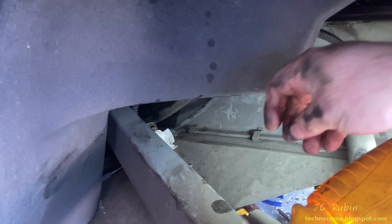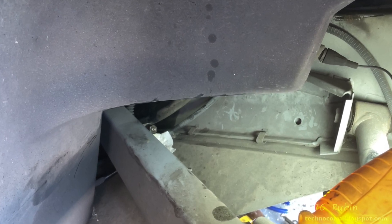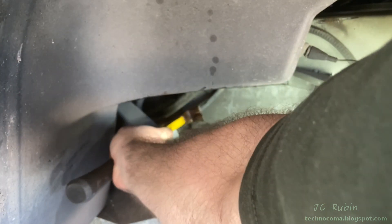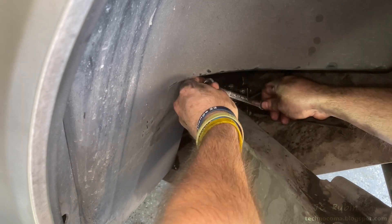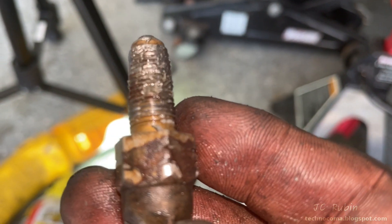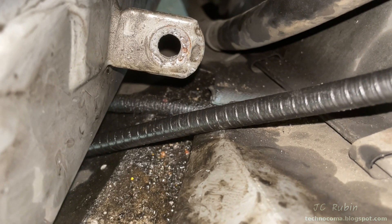All I have to do now is remove this nut and the hose and I'm home free. Before folks ask why I didn't remove the access panel below — a couple of those rib nuts are spinning free and I just don't have a choice right now. I tried gentle tapping but there are no gussets on this bracket, so tapping is a bad idea. Turning with vice grips didn't work either. I ended up fashioning a puller from my shovel-head engine, wrapping it around that bracket — the middle part pushes the oil line right out of that bracket, and it worked. Some AMF technology for the win. This hose removal was the worst part of the rear brake job so far — look at the damage on these threads. Terrible. But I have to clean up the area and remove any brake fluid from the frame.